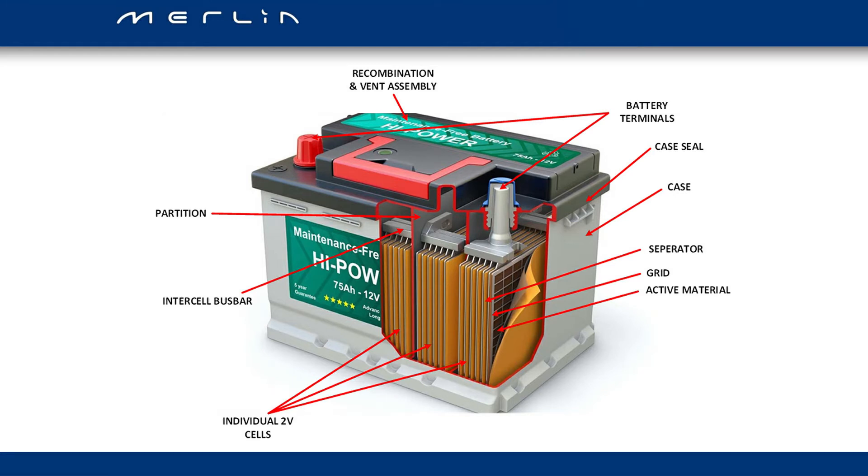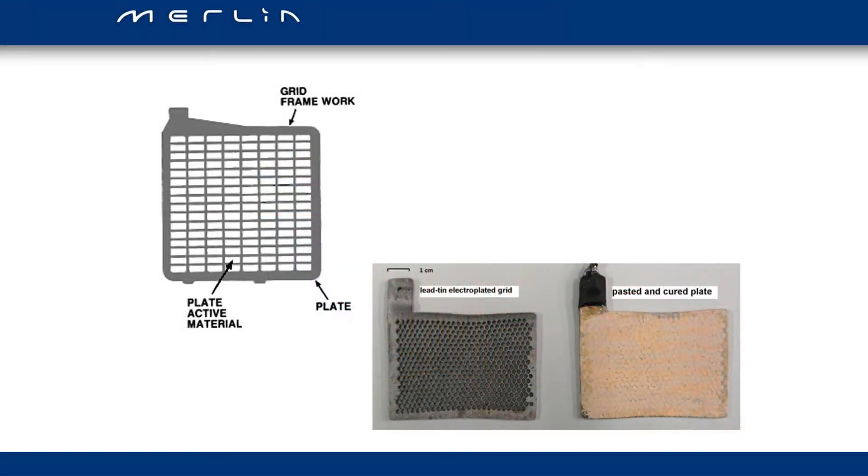A battery is made up of battery plates. Each plate is made up of a grid, within which is pasted something called active material. Positive and negative grids are stacked together with separators between them to form a cell, each rated at two volts — in a 12 volt battery you always have six two-volt cells, connected in series using intercell bus bars. Those plates are made from a grid framework that's either cast or stamped out of lead, then pasted with active material which, once cured, looks a little like plaster. Within a Full River battery the pasted plate is cured for a total of 10 days before being put inside the battery, which is quite unique.